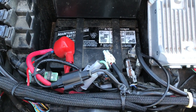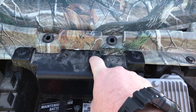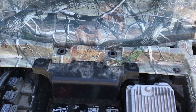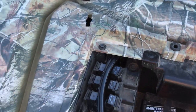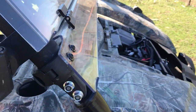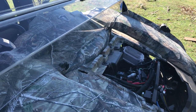I tried to heat-shrink everything on there to keep everything waterproof. Getting to this ignition switch hot lead is underneath here, and it's real hard to get to if you're trying to reach in from under the fender wells. What I was able to do — it took probably five minutes — was take all the screws out all around the perimeter of the plastics and the push pins out of the inside, both sides. Then pull the plastics up to where the mirror was, and that gave me room underneath there to where I could reach in and wire up my hot lead.